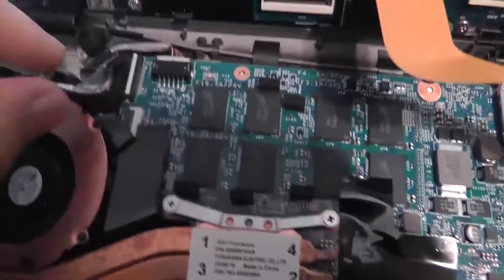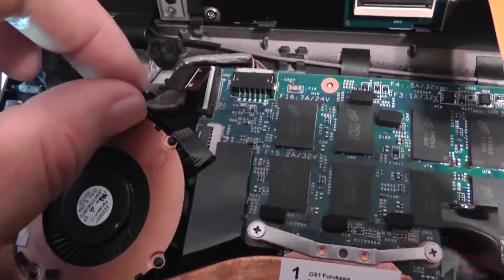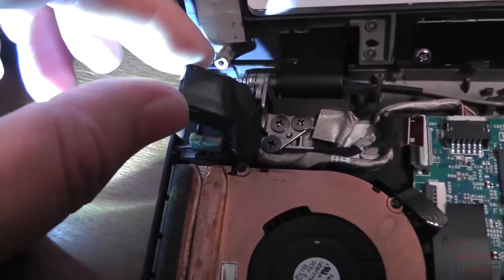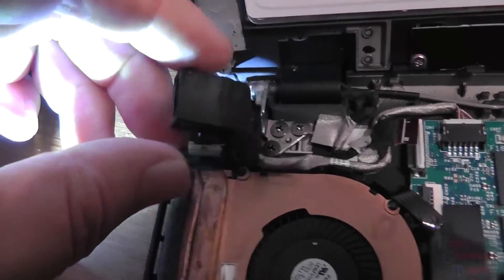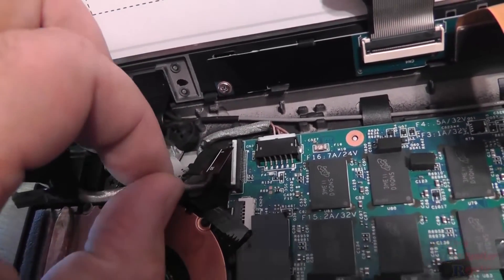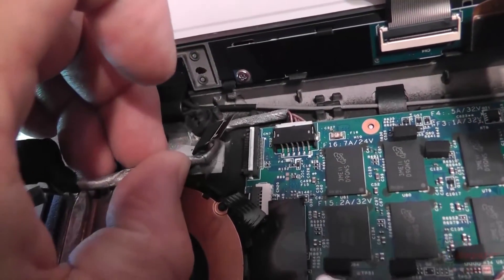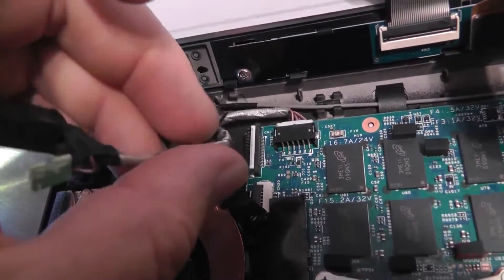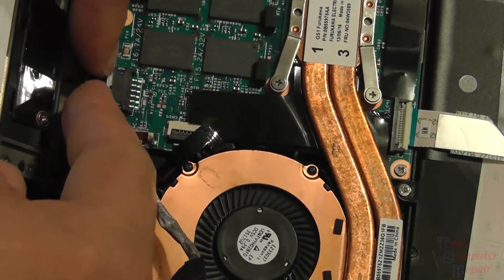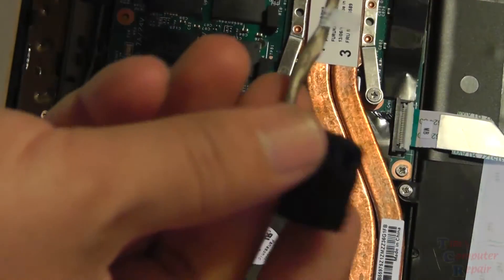There's a little PCB board attached to the power jack, and that is actually your power indicator light — the light on the outside near your power jack that shows you're getting power. We'll carefully lift the cable out of its trace, making sure we're not taking anything else with it. It's taped down at one point, so just remove the tape and then we can unhook the power jack from the main board. Just be sure to remember how everything goes back into place — take photos if you need to. From this point we're pretty much ready to replace it with the new jack.